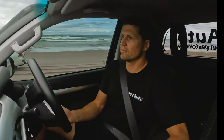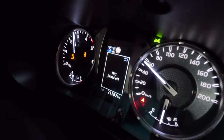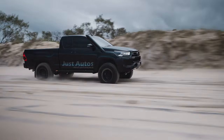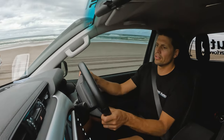We're in second gear doing just over 40 km/h. We're already up to 95 degrees in transmission temp and we've just started. In the soft sand it's amazing how quickly this is climbing. The car's doing it quite well in standard form, however it is getting hot.